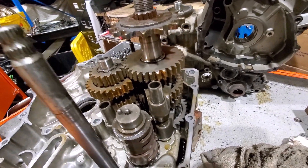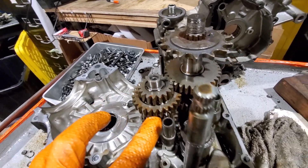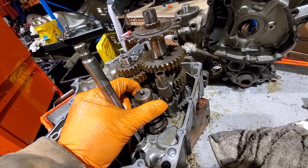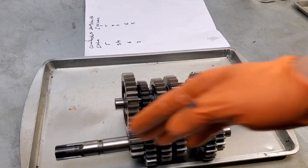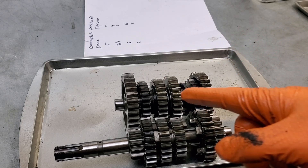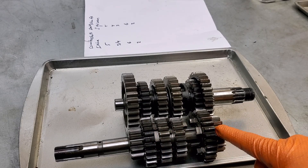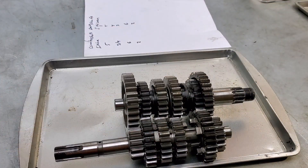And then of course you have gears - gears, gears, gears. They're in a kind of weird order that's dictated mostly by space, because you can't have two big gears right next to each other or they'll be in each other's way, and probably dictated by how the shift forks need to move. So here's the transmission laid out front to back. On the countershaft you have the drive gears, and on the drive shaft you have the driven gears. So this would be first, fifth, three, four, six, and then two - the gearing is laid out a little weird to make sure everything fits so the cases aren't huge.